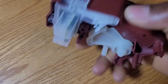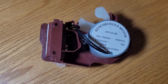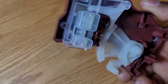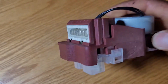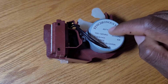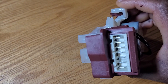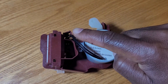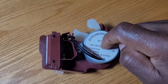This is the actuator — I bought this off Amazon. I must admit that the culprit for the breakdown of my washing machine was the actuator. I did install this on the machine and it actually worked, but I decided against using this particular one. This thing sticking out is actually the motor; it has an arm attached to it with a little hook that connects into the gear shifting mechanism on the machine. Every time you energize this motor, the arm shifts; every time you de-energize it, it shifts back to the default position, changing the machine from spinning mode into agitation mode and vice versa.